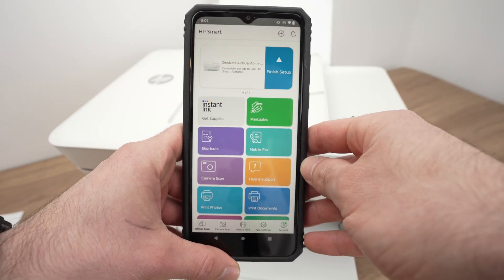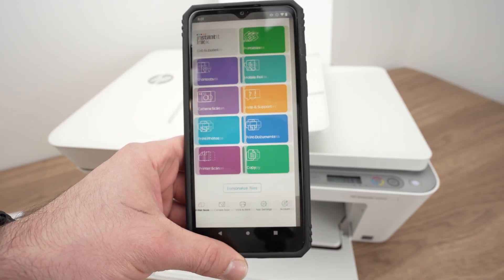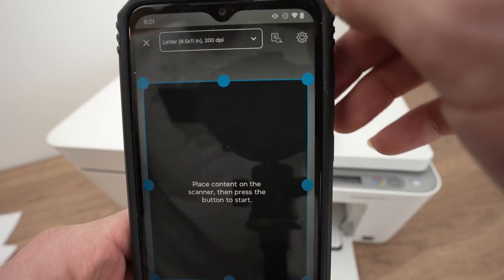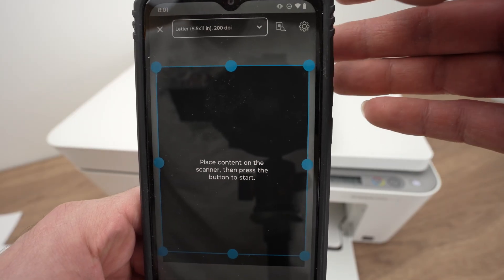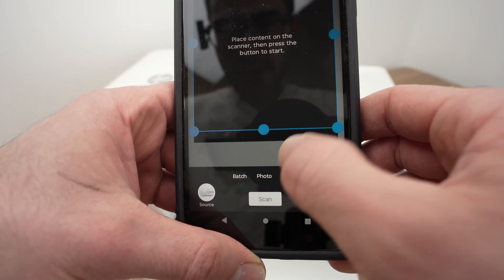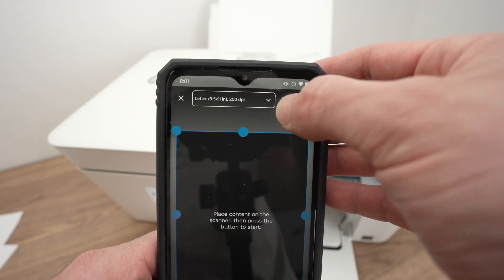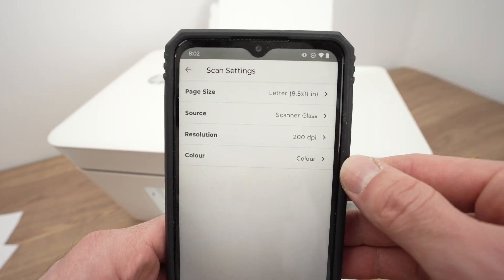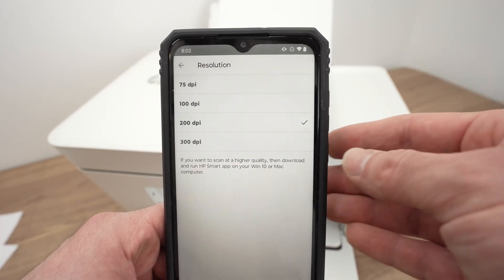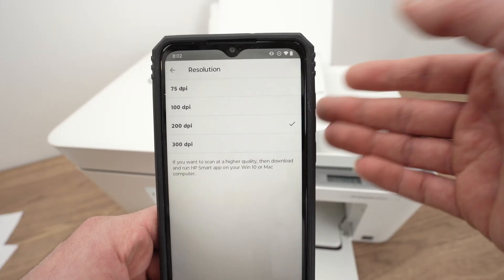Go to the app's main screen and find Scan — select Printer Scan. On the top, make sure you've selected the size of your paper; here it's US Letter size. By default it's set to Document, but if you're scanning a picture you can swipe and select Photo. To access more settings, click the settings icon where you can change a few options. One of the most important, in my opinion, is the resolution — it's 200 dpi by default. If you're scanning pictures or detailed content like a painting, select the highest number, but for a document with text 200 dpi is enough.